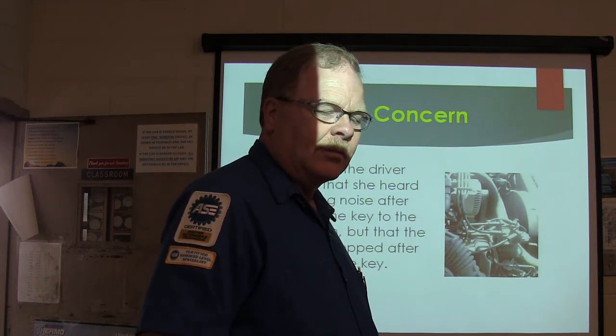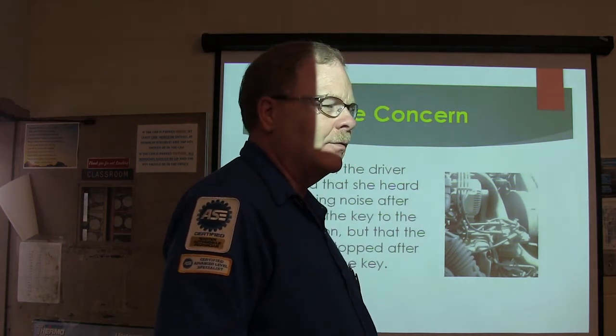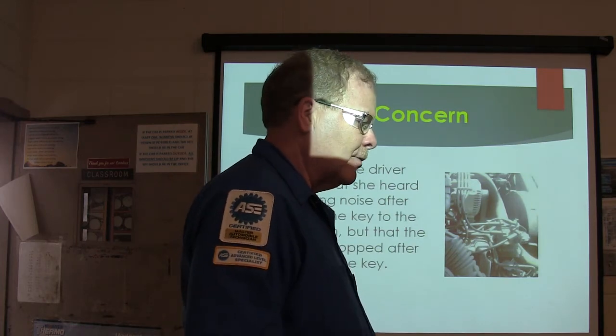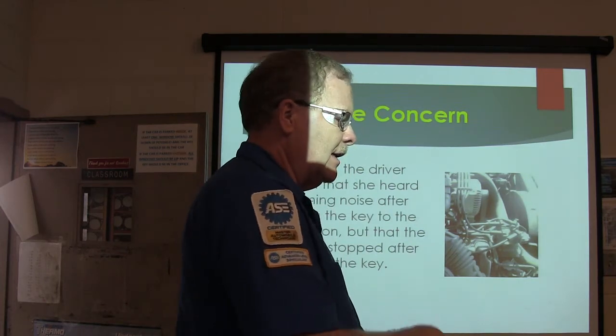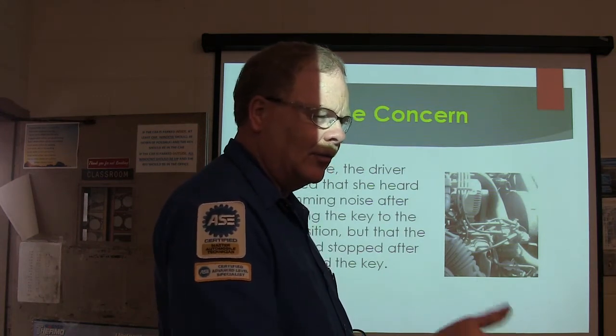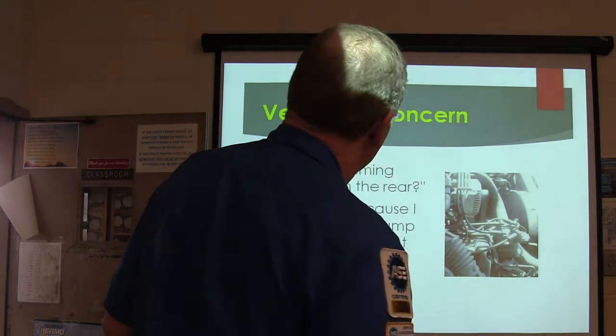Well, if you jumper those two wires together, the fuel pump runs all the time. I had actually seen people plug something into there, like they were checking. They thought they were setting the timing, and they'd unplug the spout connector and set the timing, and somehow get confused and plug that back into that, and then the fuel pump would be running all the time. That's what popped into my mind: somebody had the fuel pump running all the time.